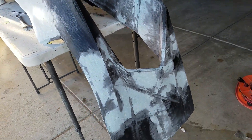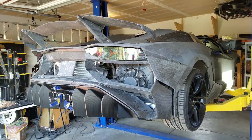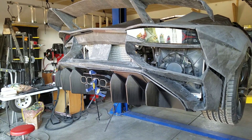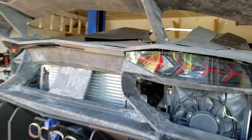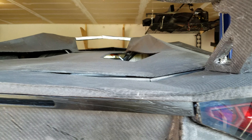What we do is we glue the parts together and get them to fit on the vehicle, kind of lining them up with the panels that we've already done. The rear fascia is actually the kind of master panel that we line everything else to. You can also see that sometimes you get a little bit of gapping — we're going to have to take care of that with some shims and whatnot.